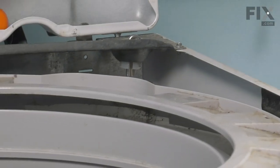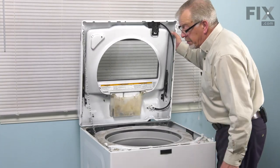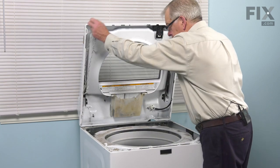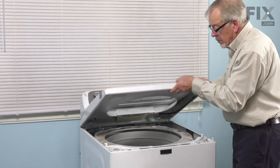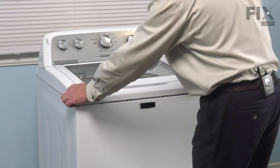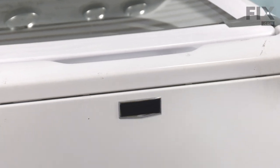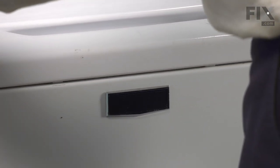Now that we have all four of them replaced, we can go ahead and put our main top back. Tilt the top and lid forward, disconnect our lanyard. Now just make sure that top is even side to side — it should drop down to about a quarter of an inch space in the front. Pull it forward until it drops down flush, then push it back. It should be a tight fit between the main top and the front panel, and you should not be able to lift up on it. We can then release the tape from the lid.